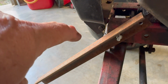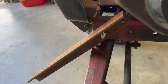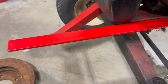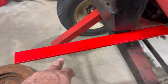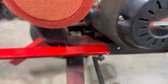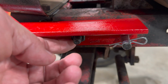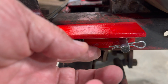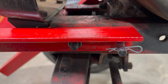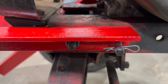I'm gonna go ahead and take this off, center punch these 2 holes, transfer them onto my other piece of metal, and bolt it up. Okay, everybody, I got these 2 pieces done, drilled, and I was gonna run double bolts in them, but what I'm gonna do is just bolt the front one. And this second one right here, I changed my mind. I'm gonna put that pin in it. So when I have to get the hood off, I can, and I'll show you.